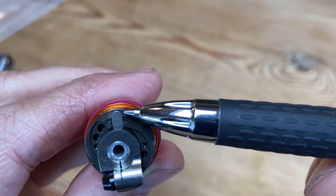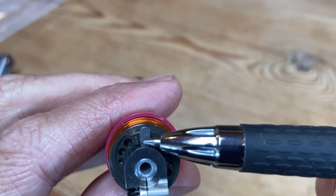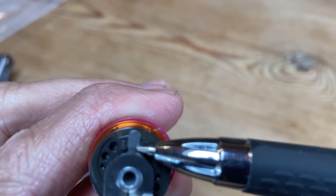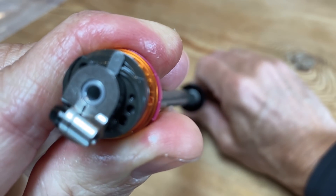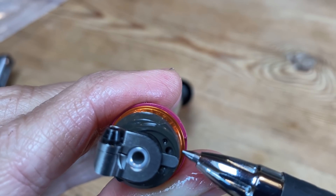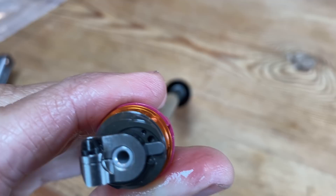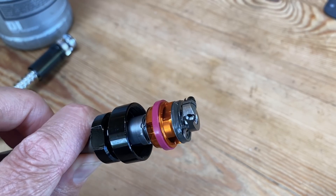Here's the little wing — that's actually the spring you're acting on. Here's the ridge that's changing the position on this piece to change the amount of leverage for the valve stack. As it sits right now, the ridge is really far in so it doesn't have much leverage, making it feel very firm. When you open up high-speed rebound you can see it's now resting out on the edge, giving it quite a bit more leverage and making it feel like a lighter valve tune. Pretty simple, but it makes a massive difference in ride feel and range of adjustability.